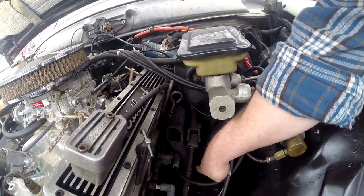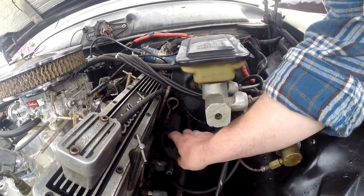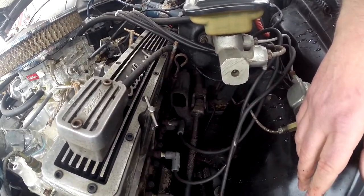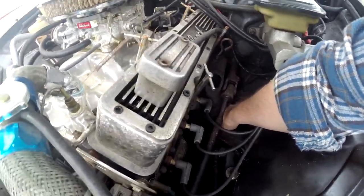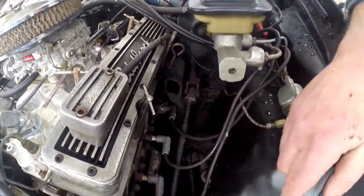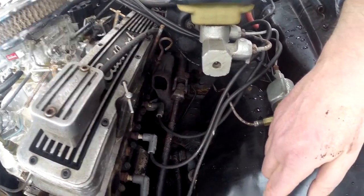The headers conflicted all over the same areas — the steering box, the lower control arm, and this panel down here where it's actually hitting — and this is why I can't just put a manifold on here. You can see there's a conflict down here and as the springs rise up, this thing is constantly putting pressure upward on the manifold, so that's why it cracked. That'll just happen again.